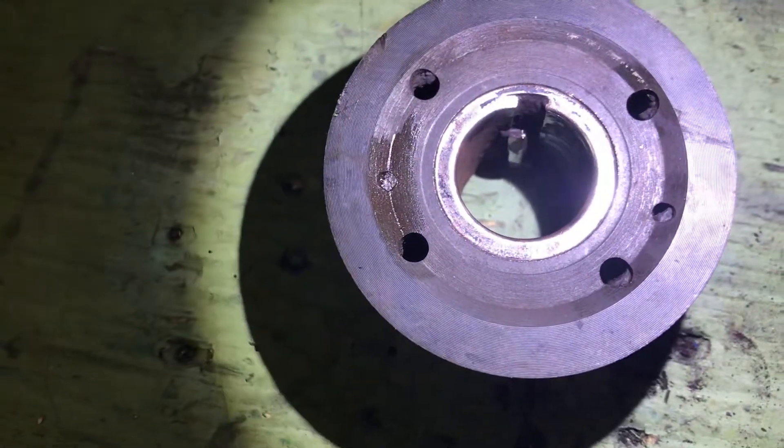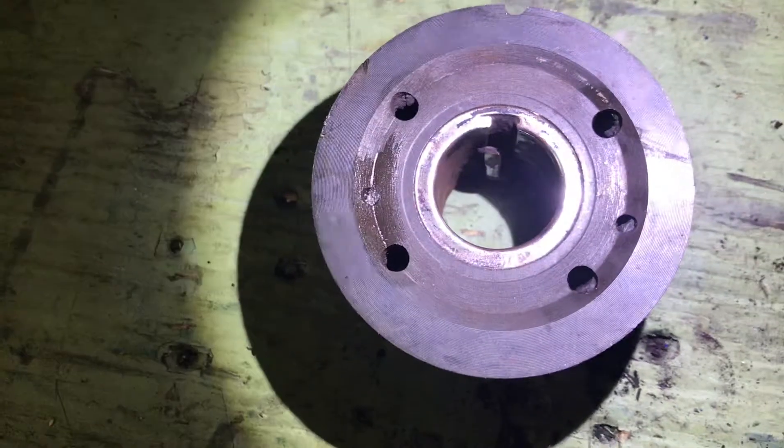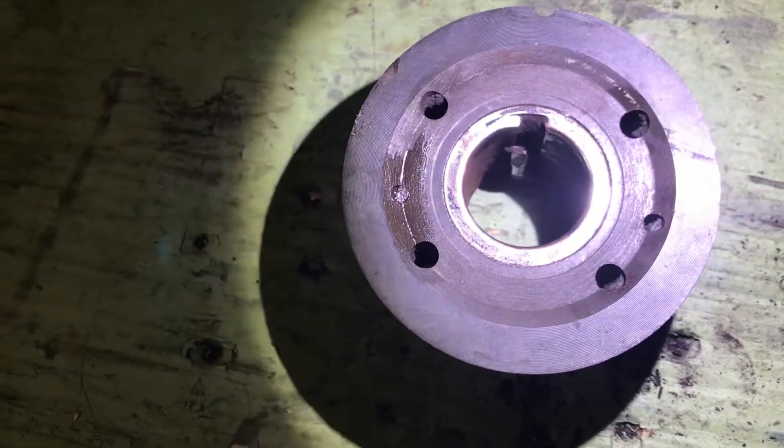See how the key is lodged and moved over? So along with the millimeter on the crank, it's about a millimeter off on here too. So yeah, that caused the timing to be way off, causing the car to have basically no power.